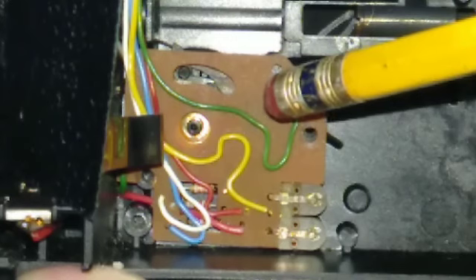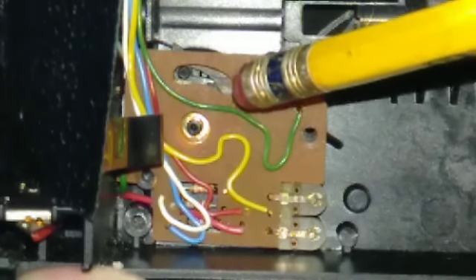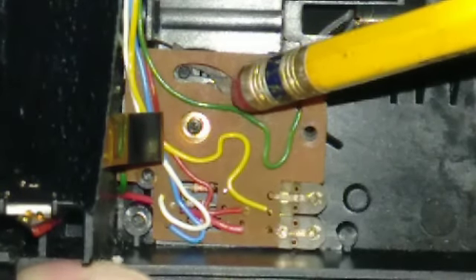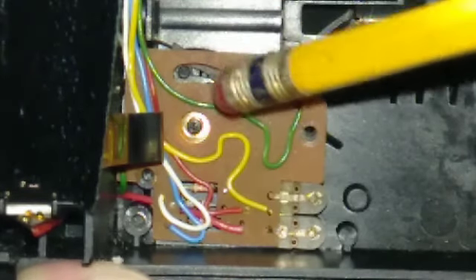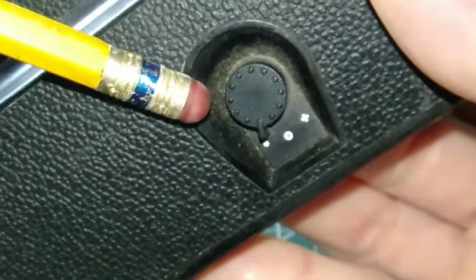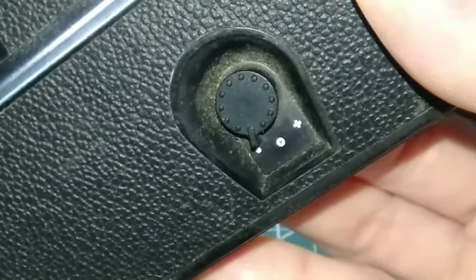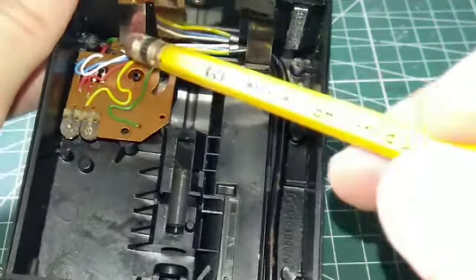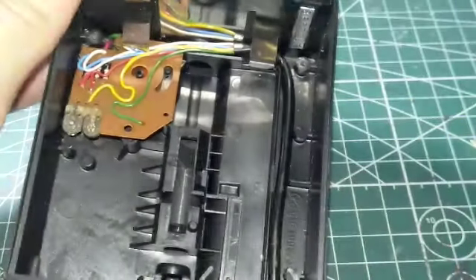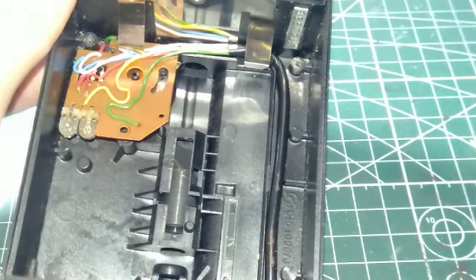Here's where it gets tricky. Underneath this PC board is what's known as a mode switch — it's the switch for selecting the functions of your camera. It is a piece of thin copper plate, very bendable, molded onto a piece of plastic. You need to first take note of what position the selector knob is currently in before disassembly. My selector knob is in the position as shown. I'm going to remove these wires from under this sheet metal and pull the whole PC board back — underneath it are some really loose parts associated with that switch.